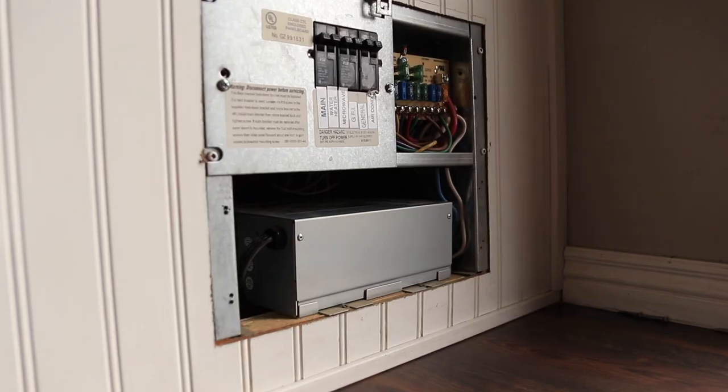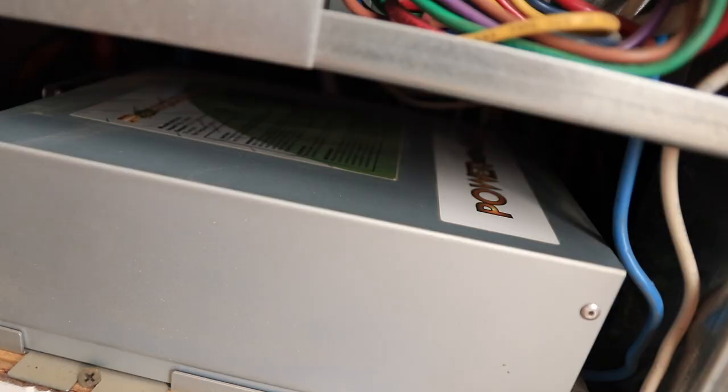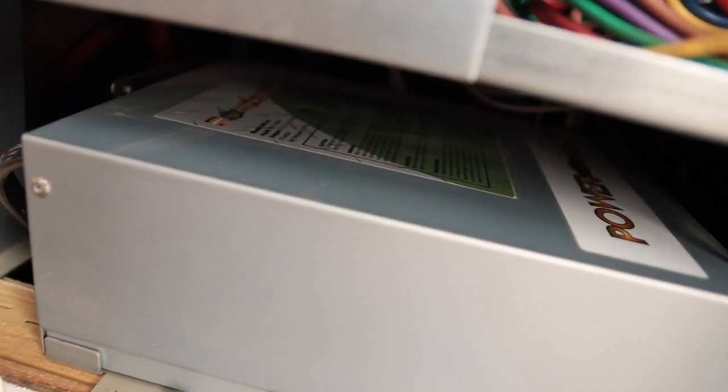The last one — the fifth one — isn't the most simple change to make, but there will be a video coming up on how to install one of these and it's really not that hard. It's a smart converter. So many of these rigs come with a converter for charging your batteries that is like a single stage. Now they make smart converters so that when you're charging your battery you have multiple cycles it can go to. If your battery is really low it can charge it a lot faster, then move to a medium range, and then go to a trickle charge to maintain it. Being able to charge our batteries faster without overcharging them makes for a more intelligent charging system. Check the link in the description to the converter charger.